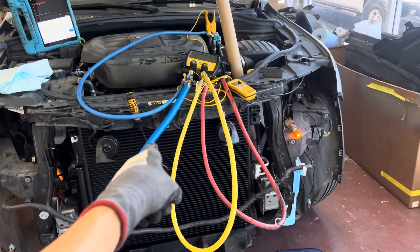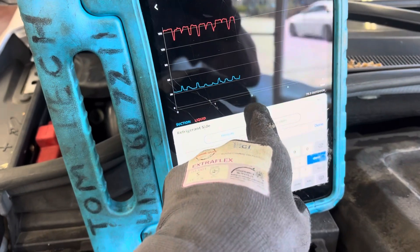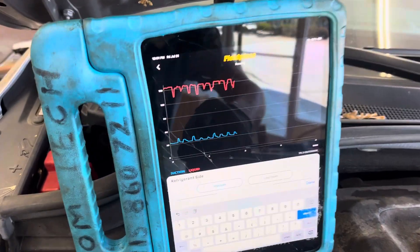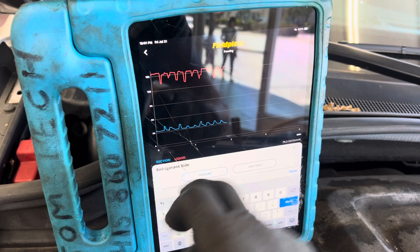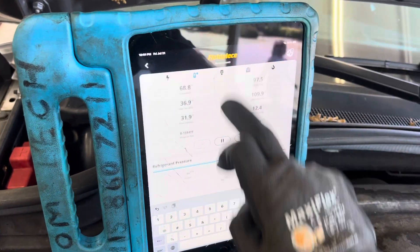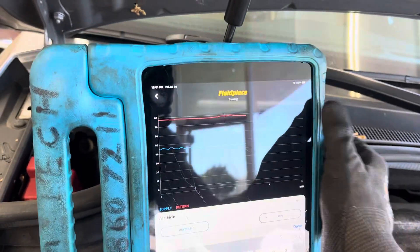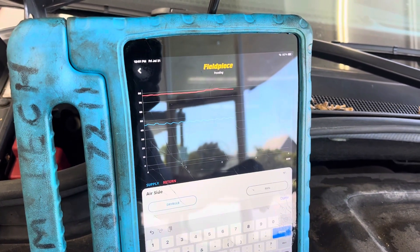Real quick on this 2017 Jeep — it's running, been running for coming on three minutes. It took almost a minute for my scanner to boot up, but it's cycling right now. You can hear the clutch kicking off and on. You can see the pressure cycling off and on, and if you look at the temperature, you can see the little up and down because the clutch is cycling right now.